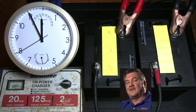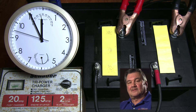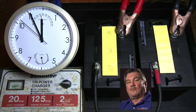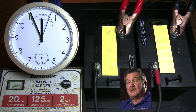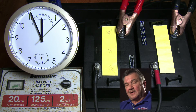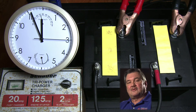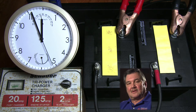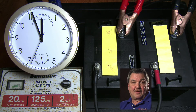There are only a handful of battery manufacturers with nationwide distribution. They will say that they tested Battery Demister and it does not increase batteries' life cycles, and most will say that it voids their warranty. Let me address the warranty issue first. The national average of new batteries that have warranty issues within a year is around 1–2%, or 1 or 2 out of every 100 batteries that go bad within a year. Some battery manufacturers average less and some average more — again, you usually get what you pay for. To basically eliminate your chance of getting one of these failing batteries, do a hydrometer test to check the specific gravity in each cell before putting that battery into service. All cells should be equal. If one cell is lower than the others, do not put it into service — return the battery for a replacement, because it will fail within a relatively short period of time, usually just after your one-year free replacement warranty is up.